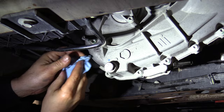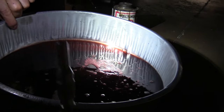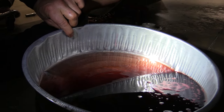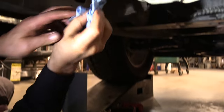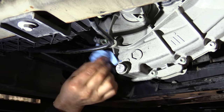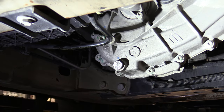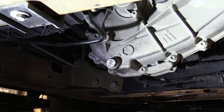That Amsoil fluid — you can see it's starting to darken somewhat. I've seen them a lot worse. As it oxidizes and breaks down, it gets darker and darker. But with Amsoil fluid, you can go easily probably 150–200,000 miles on it. Just let the color be your guide. That's it for the transfer case. Do it with the transmission and you're done for a while.